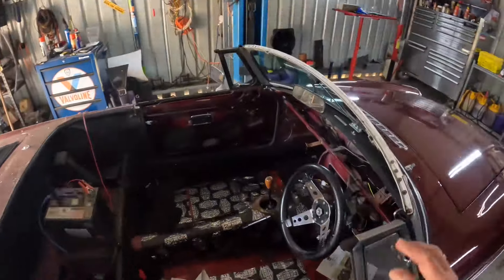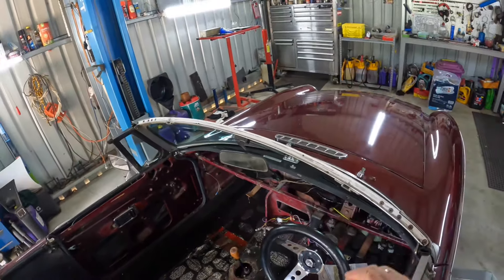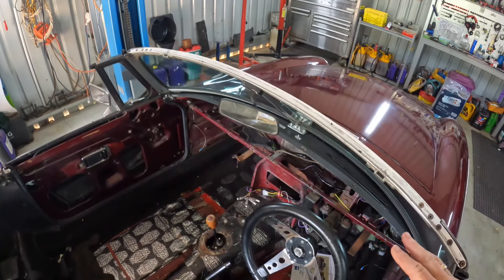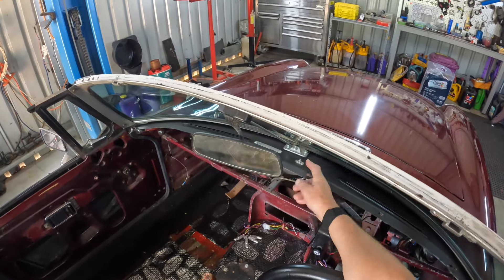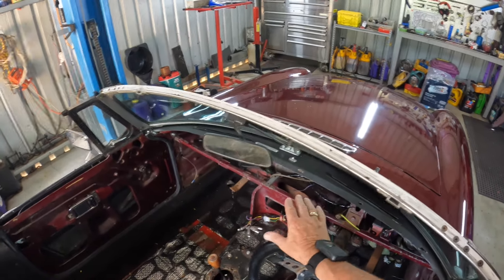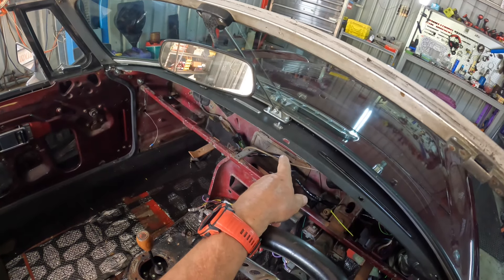The vinyl is all really good. The more observant might notice that on the center support bracket here, when I was trying to get the bolts to line up with the captive nuts held underneath the dash, it was very, very difficult and very, very frustrating. In the end, what I did was wind a bolt up from underneath so the thread came through, then screwed two lock nuts onto it. I know it's not standard and mine's not a concourse car, but it made doing this job an awful lot easier than trying to line up those bolts underneath.